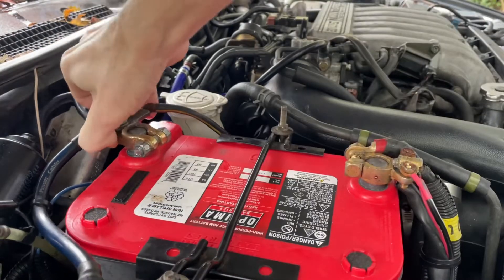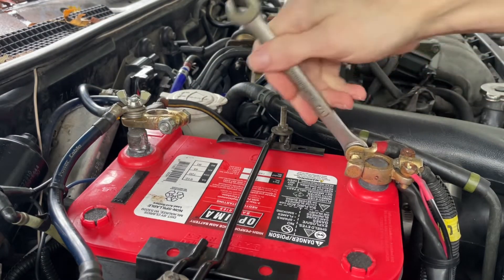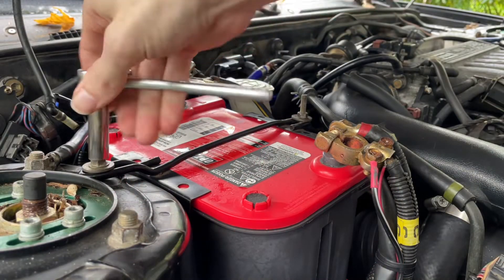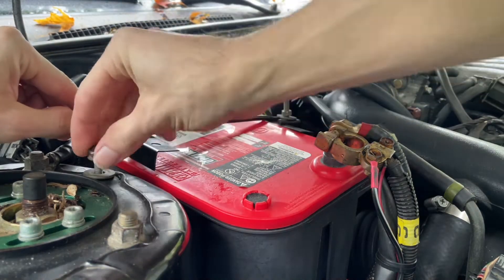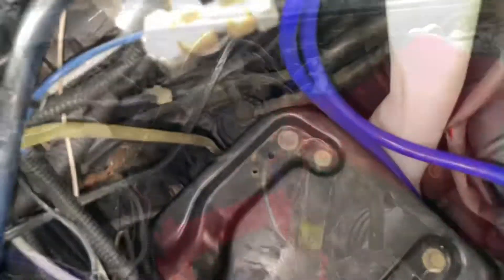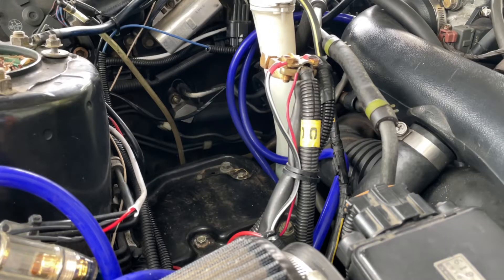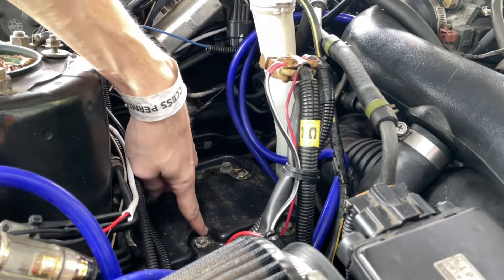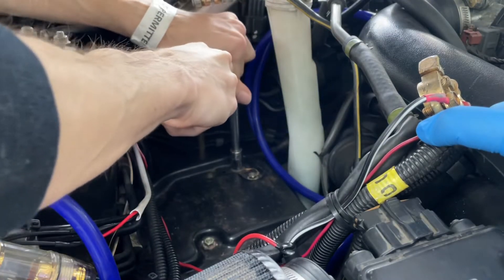This is watch Dave make a snuff film. In order to get to the fuel filter, you need to remove the battery. Next, we're going to remove the battery tie down — the factory nuts are 10 millimeters. That's the fuel filter just behind the battery tray, so that's why we have to remove it. The battery tray is connected to the chassis with four bolts. The other two smaller nuts here and here hold on to the washer fluid reservoir. I'm using a 12 millimeter socket with an extension.